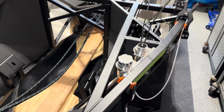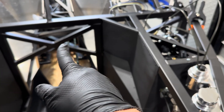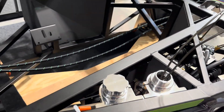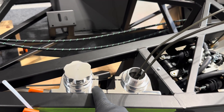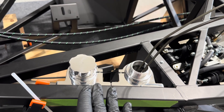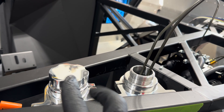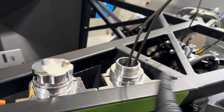Jumping over to brakes. In the last video I was talking about not being sure where I wanted to mount the reservoirs — whether up on the firewall somewhere or on this side of the foot box. I watched some videos and saw a couple where guys had mounted them here, though one had an L bracket mounted to the top of the frame member raising everything up. I was a bit worried about having things up that high and how well the body clears. I had three reservoirs that came in the complete kit. I'm opting to use two — the front one for the hydraulic clutch and the other for the front and rear brakes.